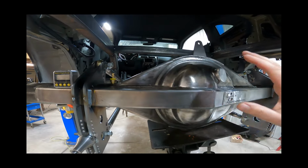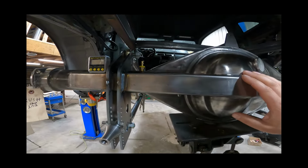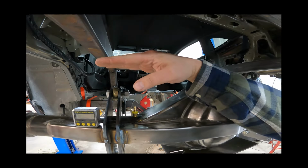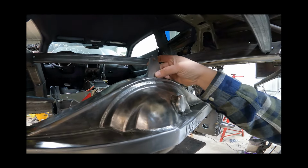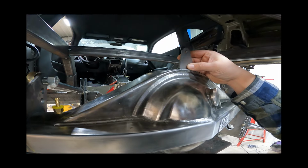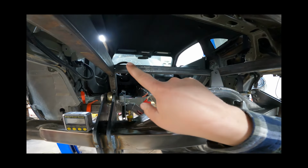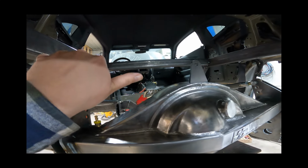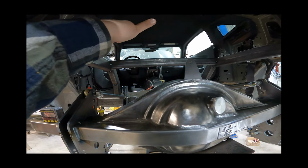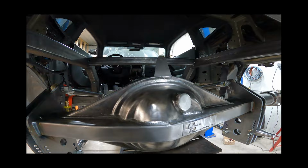Now this is what we want to be our ride height. I should specify that. So all these measurements for bars and everything, this is all made where we expect the rear end to be at ride height. Now, you want your panhard bar, to my knowledge, to be basically flat. So we got the tabs for the rear end, and then we've got tabs to also come over here off the bottom of the frame. Now that should put us pretty close to flat. The reason for that is because as the bar drops, the bar length doesn't change. So as the rear end comes down, the rear end's actually going to swing this way. I'm over exaggerating, obviously. And then as the rear end goes up, it's going to push that way. So if you're in the center of the arc at your ride height, it should be minimal travel both directions.